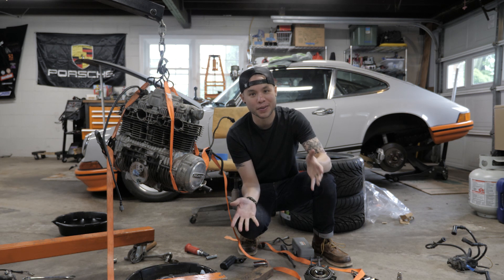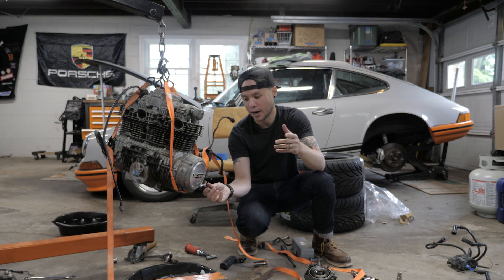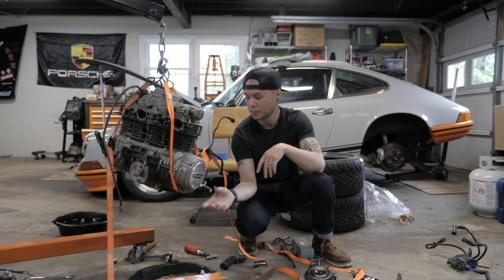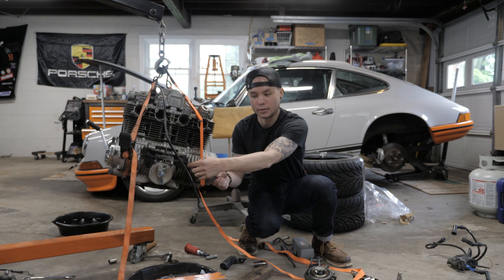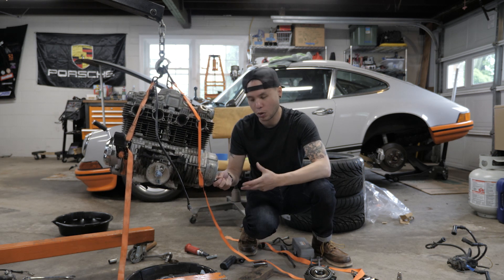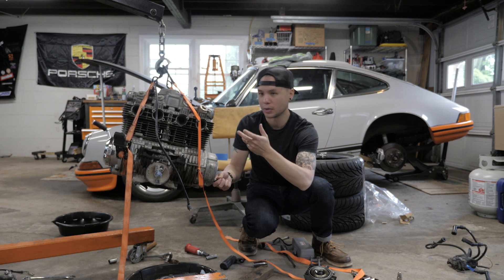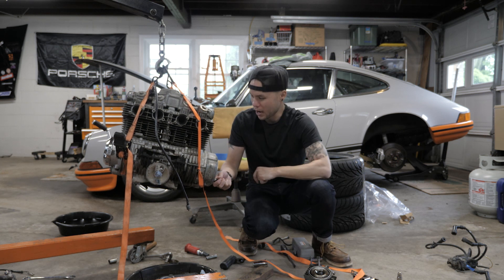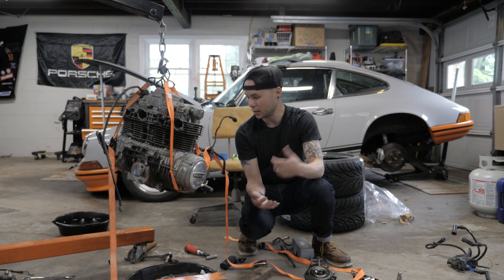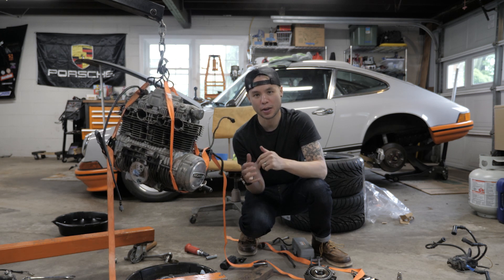In the motorcycle, very important, you've got to take off the front little oil cooler, but you also have to take off the whole sump on the bottom in order to get the clearance to get out of the frame nicely. With the right combination of pulling stuff off, as well as just tipping the frame back and forth, we finally got everything clear and got the engine out of the bike.